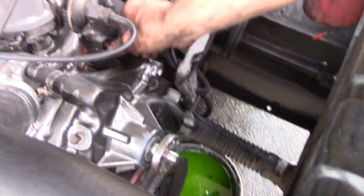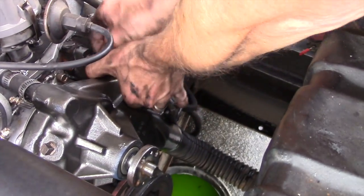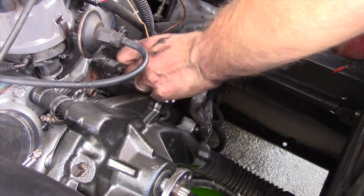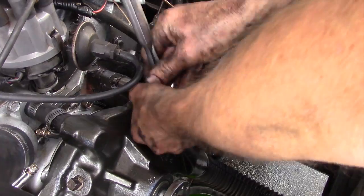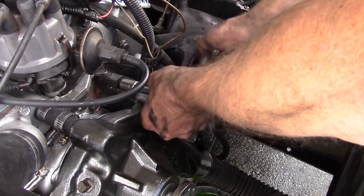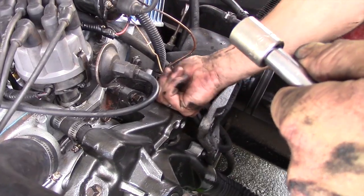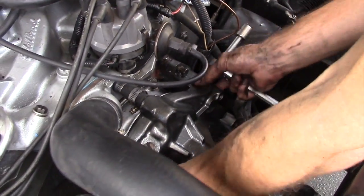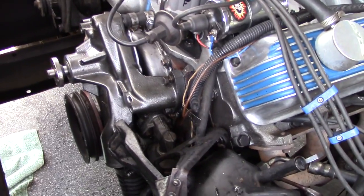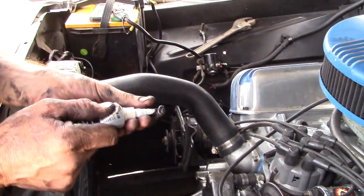Looking clean, man. And I always put in all 4, just kind of finger tight. That way it gives you wiggle room for getting that last one in. So this one's to line things up. Then I'll put the more difficult ones in. Then once they're all in, then I'll torque them to specs. For that bottom one, a little sealant at the end there.